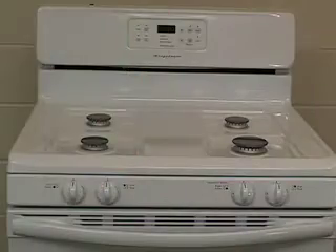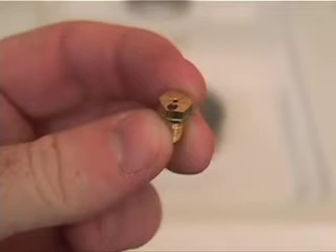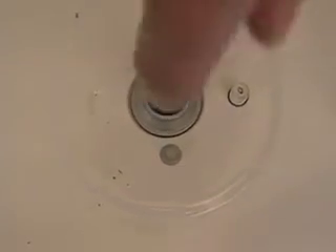For the top of the stove, remove the burner cap and head. Take a seven millimeter nut driver and remove the natural gas orifice. According to the conversion instructions, an orifice with a red dot is needed. Replace the orifice and the burner head and the cap.